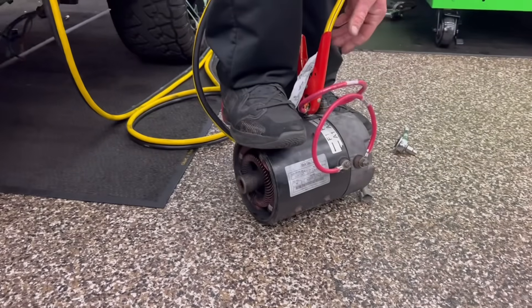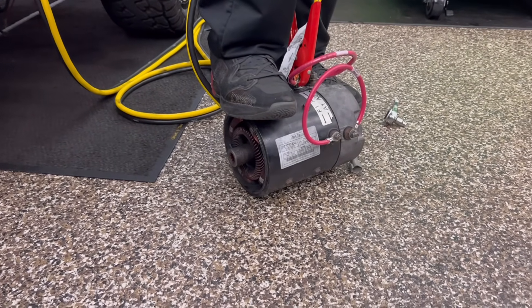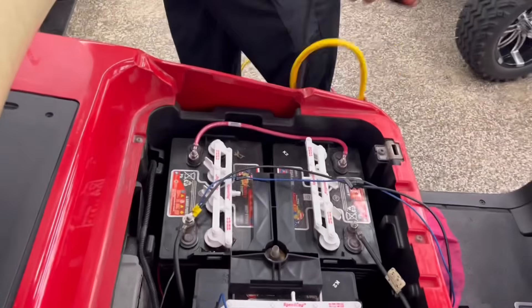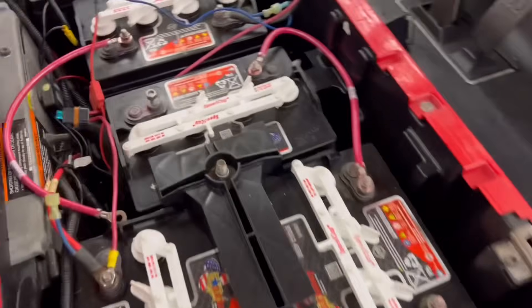Now you hear that rubbing? You don't want to let it sit and rub like that because it would cause problems. Don't hold it no more than about three to four seconds — but that's how you test it, man, simple as that. If the motor spins, it ought to spin on the car. If you want to test the field winder and make sure it's not shorted — it ain't gonna be shorted if the motor turns. You can watch my other videos. I got 300, maybe 400 videos by now. Stay tuned, man — subscribe. Golf Cart Whisper, subscribe.